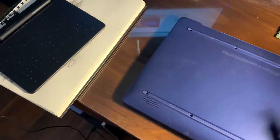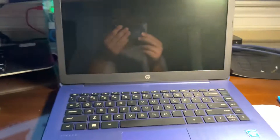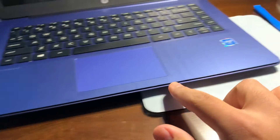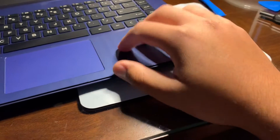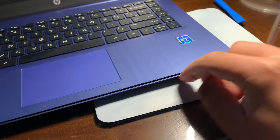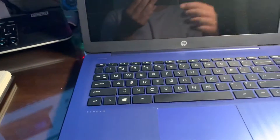I'm going to flip it back over and replace the back cover. It's a very standard laptop. You just put the pick between the plastic front panel — the palm rest part — and the bottom shell, and that's how you get the clips off. Just do that all around. When you get to the hinge area, flip it over and follow the same steps as before.